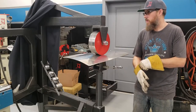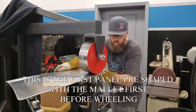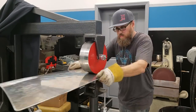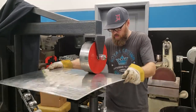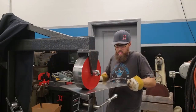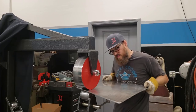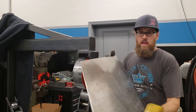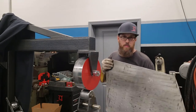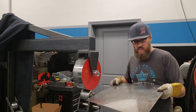I'm going to be wheeling up the panel to these divots that I made with the hammer and the panel bag. I don't know if you can see this or not, but it's got a nice little crown to it — nothing too exciting. I probably won't use the hammer on the panel bag next time on the other one. I've been working this panel for about 30-40 minutes now to get all those little dents out. This thicker material has been a little bit of a bugger — I'm used to working with 16-18 gauge aluminum and this 3/16ths has been challenging.